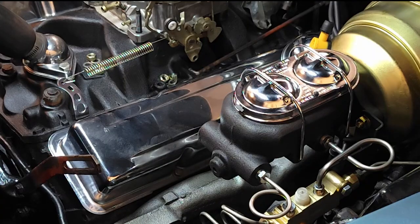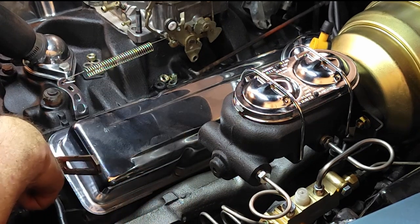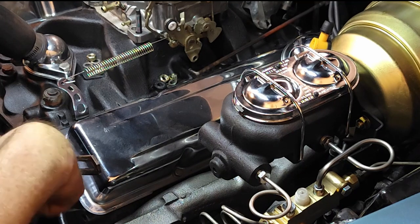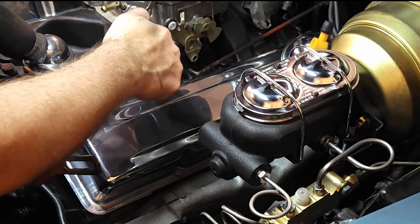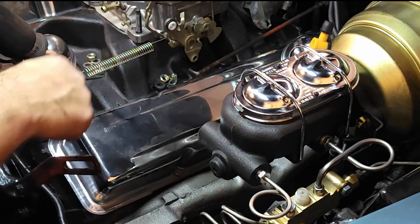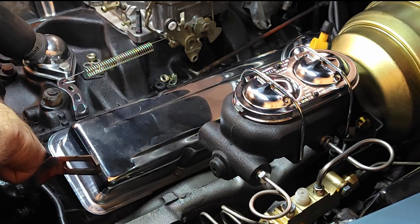Plug wires coming up on the fence. The nice brackets I like to use don't clear. I don't think they clear these exhaust manifolds. Factory manifolds always sit too high. I'm going to have to do the weird ones that bolt up with the 3 and the 4 piece. Not a huge fan of those. They work. I like something a little nicer than that.